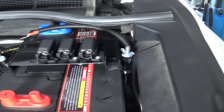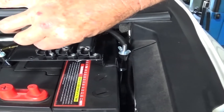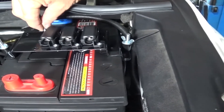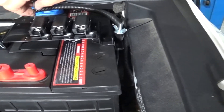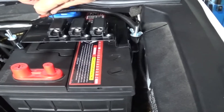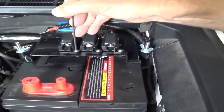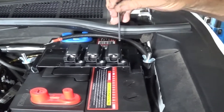There are actually more fuses required here than you'd ever imagine with the Intervolt, because they want fuses on just about everything. One of these will be for the solar, another will be for the wiring down to the back, and another one for the Anderson plug — so three of those there. Then we'll add a fourth so that we can add a fuse box in the engine bay somewhere.